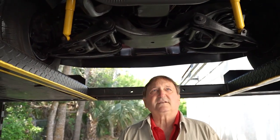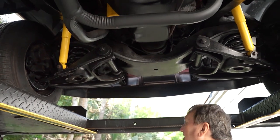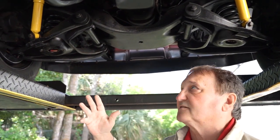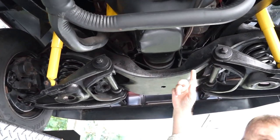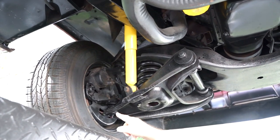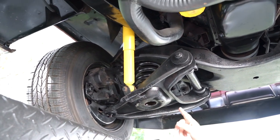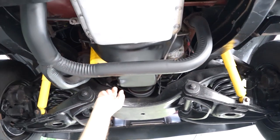This is the underside of our 1987 Sierra 1500 GMC truck. Everything on this vehicle, just looking at it, appears to be original except for four yellow shock absorbers — that's the only thing I can see that's been really changed under here. Obviously there are no leaks on the engine, which is the original engine. It has the original conventional starter, not a gear reduction starter. Heavy-duty disc brakes in the front — rotors appear to be really nice. There are no edge marks on them, heavy-duty calipers, the original springs still intact on the car, and original exhaust from what I can see — this doesn't appear to have been replaced.